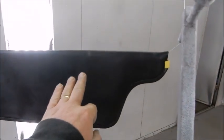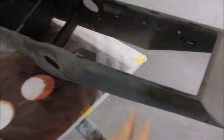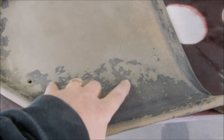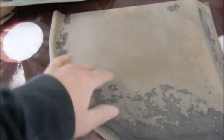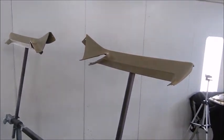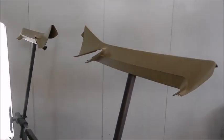There are our sun visors. We'll spray those. Got the little chrome tabs taped up. We'll put adhesion promoter on that. And the console. I'm not sure, we'll probably spray a little bit just right here on this bare plastic. Some more of this blew off, and I'll blow it off with the air hose. And we'll move that stuff around a little bit more and get it in a better situation before we start spraying. Got those right there. Those are your A-pillar molding. And that's where we're at.